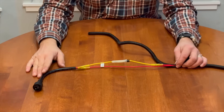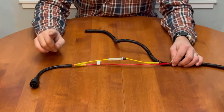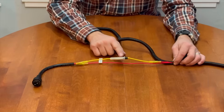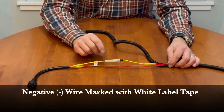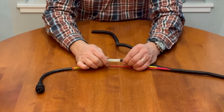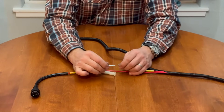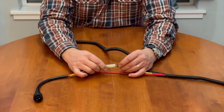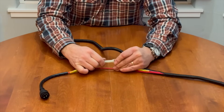We're replacing the 4-foot 14-gauge cord from the Vevor heater with a 12-gauge 22-foot cord. In order to do that, I had to put in an inline fuse. The Vevor has a fork-type fuse rated at 25 amps. I chose to go with a 20-amp - and for those not familiar with tube-type fuses, the ratings are written on the ends. 20 amps should be a great safety margin, considering it starts up at 8 amps and then runs continuously on 3.